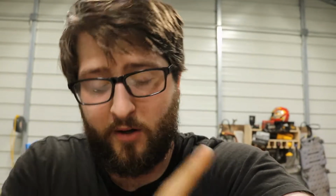Reason I'm going naturally aspirated: 1, no turbos. There's less problems, less oil leak problems you have to deal with. Turbo seals don't go bad because I don't have a turbo. And not gonna go with the supercharger on this car because you introduce a belt and you have to make sure the belt has full grip on all the pulleys. You have to make sure it has maximum grip. You could slip belts, not make the right amount of boost, lose boost when you're slipping the belt. You can also blow a belt out and rip everything underneath your hood electronically.